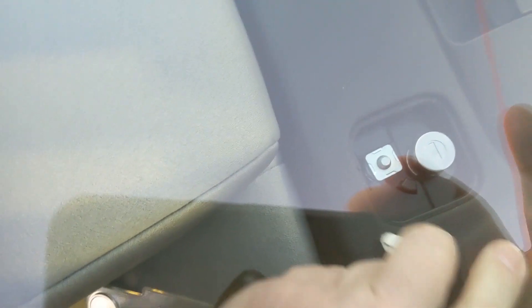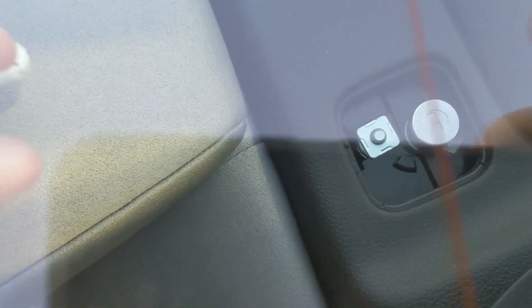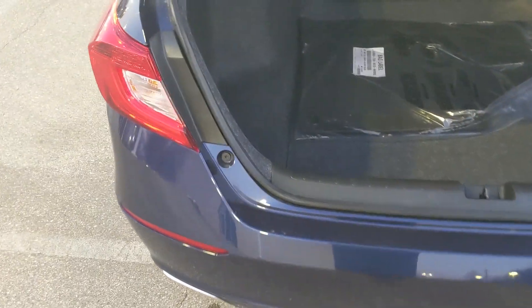After you've opened your front door, reach through the back and open the back door. Get right up in here — there will be a panel sitting here, and you're going to need your key to stick it right there and pop open the panel. Once you've done that, you'll notice there's a spot right there where you can put your key. Turn it and your trunk pops open. This way if you ever get stranded and your car battery dies, you can still get your belongings out of your trunk — whether it be for your kids, diapers, bags, or whatever it may be.